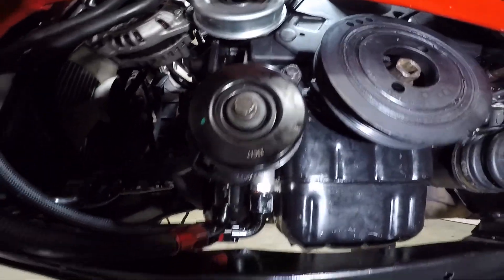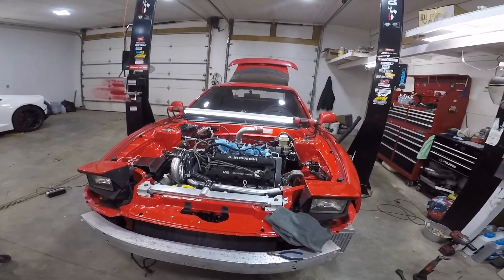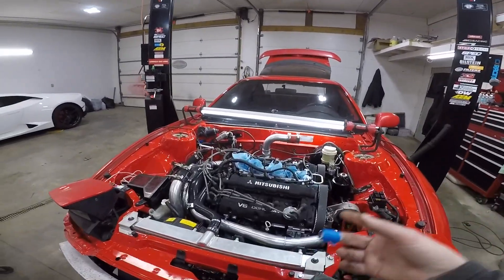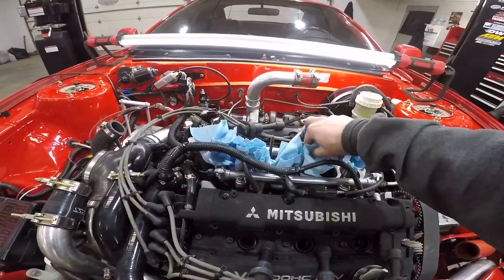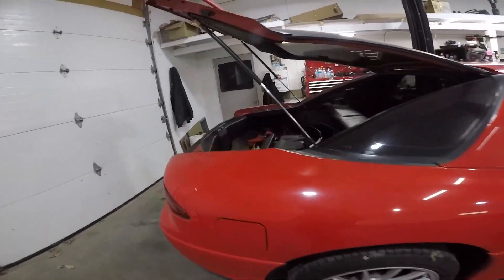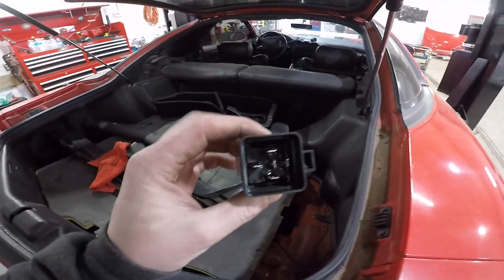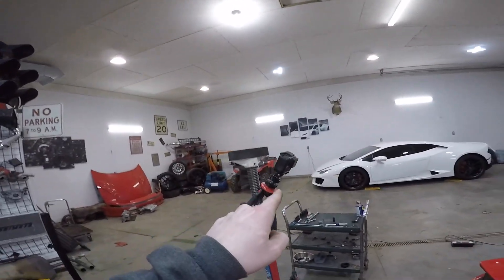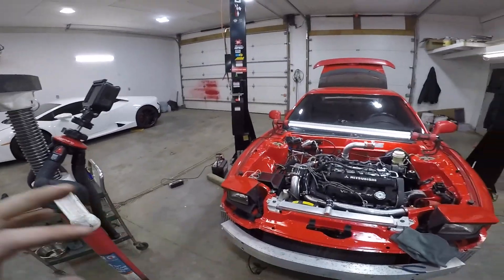Alright, tensioner pulley's on. Honestly I don't even know where I left off recording yesterday — I think I just showed a couple clips here and there. I'm pretty much ready. I'm gonna turn this thing over, get some oil up in that oil cooler, then put the spark plugs in, get the intake on, and fire this thing up. I've got my spark plug wires in order, gotta take these paper towels out. CAS is unplugged so it won't spark, and I got my fuse out of the fuel pump — pulled the whole thing out. I got the hot wire bypass so it won't get any power at all and no fuel will be pumped.